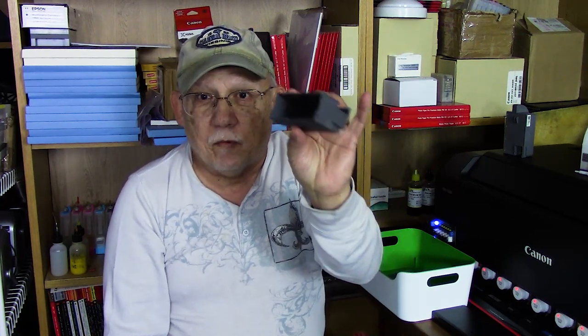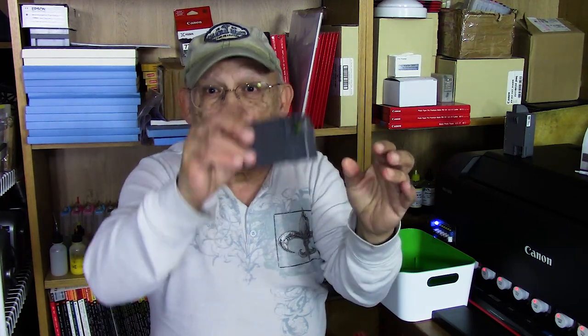I decided to go a little bit further in a second video. I removed the pads — the way I did it was I took the cartridge with the pads still installed and put it under the faucet. That washed away a lot of the ink. The fibers are basically permanently stained black and reddish wherever the biggest saturation of waste ink occurred. Once they got really soaked and heavy, I was able to just shake the cartridge over a little container and the pads came right out. Then I soaked them in about ten percent Clorox water to get them clean.